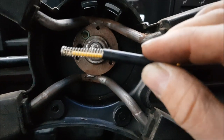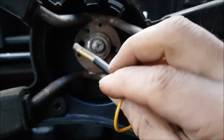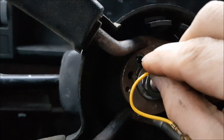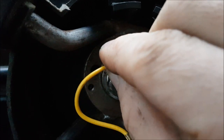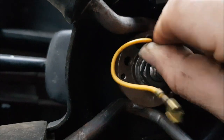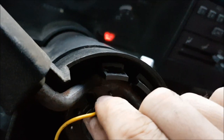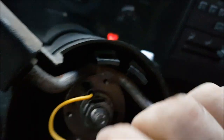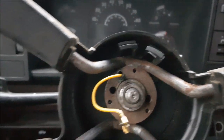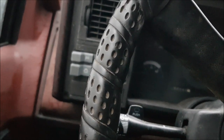Next we've got this wire right here — it's got a little tab on it and a female spade on one end that slides down in here. These things are fragile. There's a slot there — it's hard to see — but there's a slot that that tab goes in, and there's a spring on it. So you stick that tab in and turn it a quarter turn and it holds it. That's all there is to it — push it in, turn it a quarter turn, and that is your horn button wire.